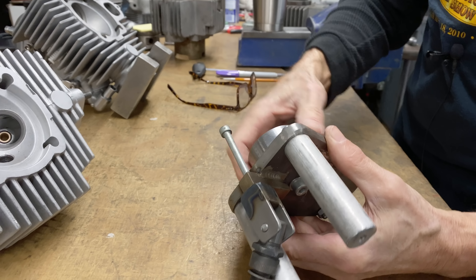These are 350s, 350 cylinder heads. This is known as the knucklehead because it had the bumps and lumps all over it. There was also a smoother head called the ashtray head - I don't like those as much. This is the cooler head for sure. This is my race head, off my race bike. This is a stock head, and what's happened on this is it's been milled down. We're going to mill about 60 thou - which is a sixteenth of an inch - off this head.